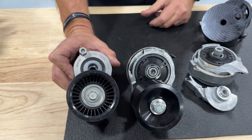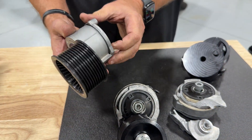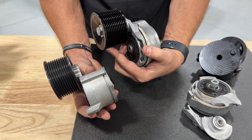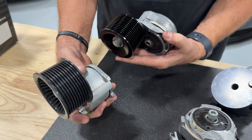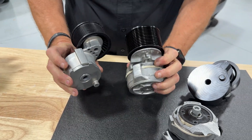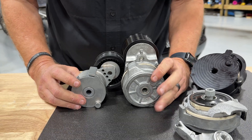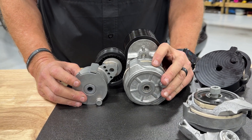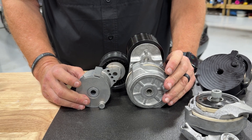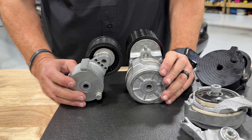It's essentially a rubber bushing with some stuff inside. From a strength standpoint and the way it's produced, it's a very inferior product. The big thing for high-performance guys is the range of motion has been dramatically reduced from the original stock part. It's not as strong and not nearly as capable — that's the tensioner available today from Dodge.